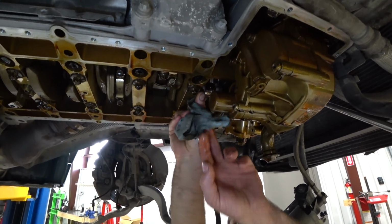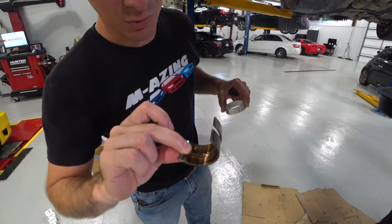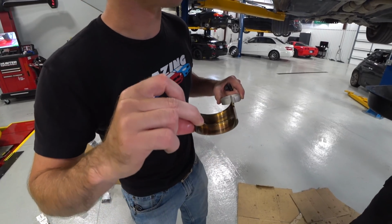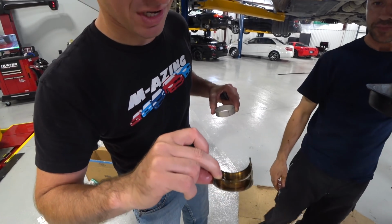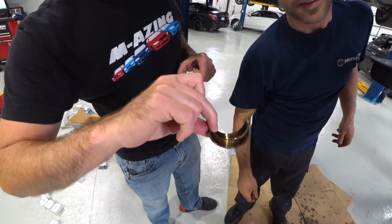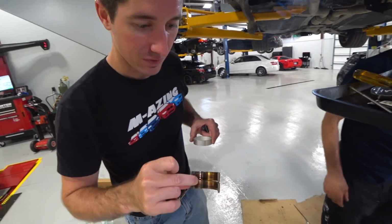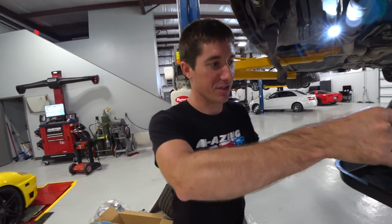Is that the compression release? Yes. I could hear that. It's kind of hard to push the piston up. We found our problem. It's the number one cylinder, and the others have not had nearly that much wear in them. How's the crank look? Looks fine. All right. These are consumable bearings basically, so that's very nice. It doesn't destroy the crank.